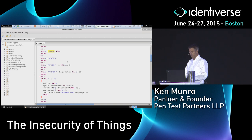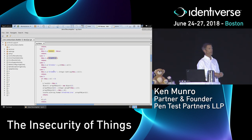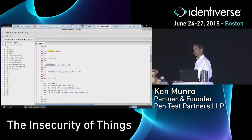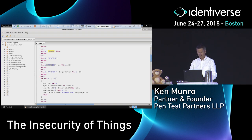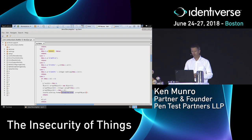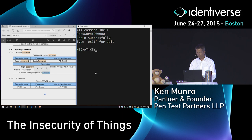Inside the app I found some interesting AT commands. One was telling the base kettle to look for your home Wi-Fi router, then look for its SSID — the Wi-Fi address name — and then ENCRY, for WPA, WPA2, or WEP if you're stupid. But then I found something more interesting: AT plus KEY. And when I tapped it in, I recovered your Wi-Fi key.